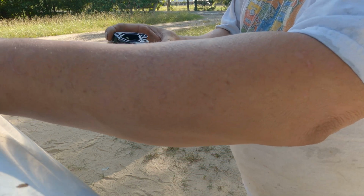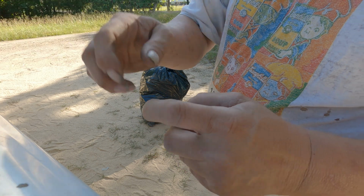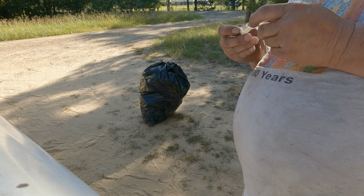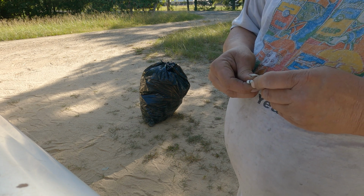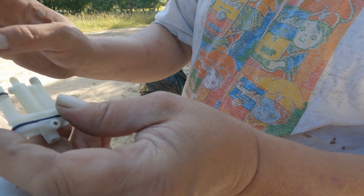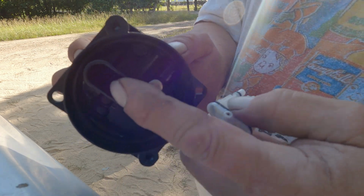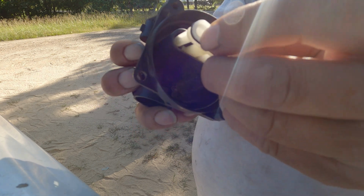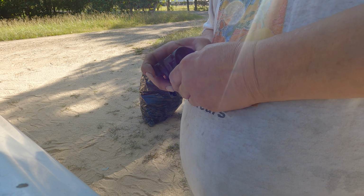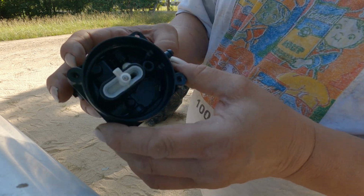At that point you should be able to reassemble this, by the way, unless you want to stick it in some sort of parts cleaner or something like that, just as a measure to ensure that it's all cleaned out. Alright, so now I've got my little jet pack pushed back together, as you can see. There's an O-ring on one side, and inside, that landing is a little taller to meet that. So you're just going to get that set up and then push your jet pack back in there. Good deal. And it'll look like that.